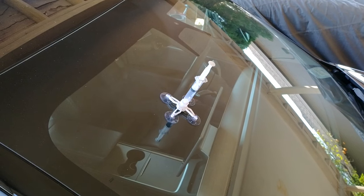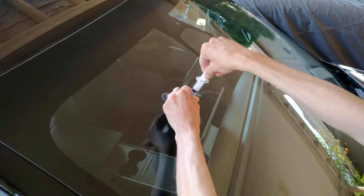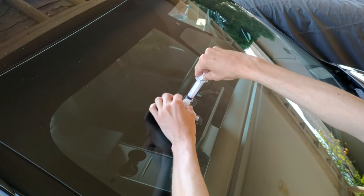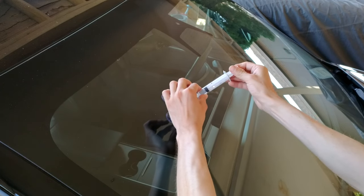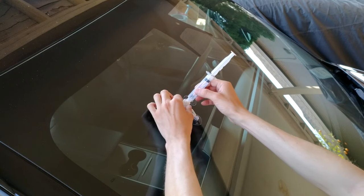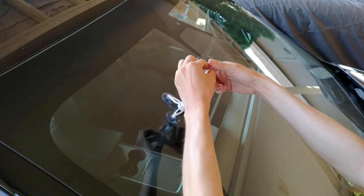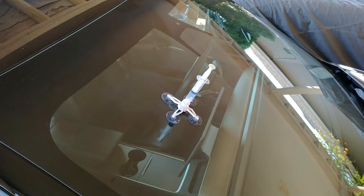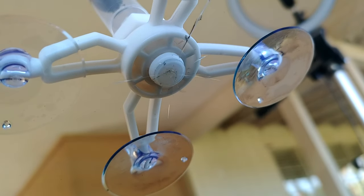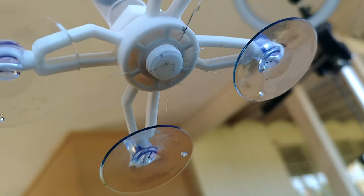It's been around four minutes. I'm going to release the vacuum and pull the syringe off of the applicator. It was still under considerable vacuum, which is good — you can see that's the air we pulled out. Now I'm going to preload the syringe with air and use it to push pressurized air in. They recommend clicking it down onto the upper notch to provide positive pressure. They recommend going inside the car to check that all the resin is being properly dispensed. It definitely looks like resin has entered the crack — you can see it's more clear, and the little bits of dirt in the crack are standing out much more visibly than before.